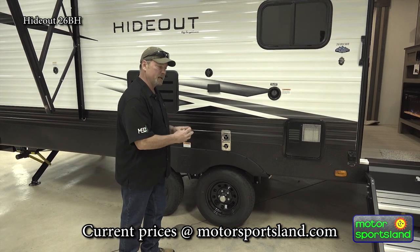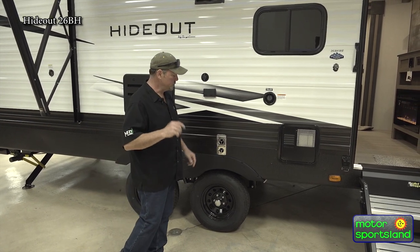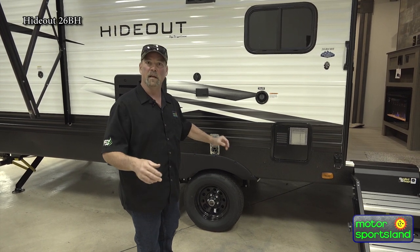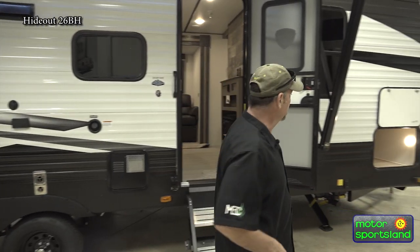It kind of greases back into that back bearing, pockets into the front bearing, and both get greased and both get nice. Little tip: as you're cruising down the road, you stop off somewhere to use the restroom for your kiddos or to go get something to eat, walk around, feel your hubs. Always nice. If they're super hot, stop, have somebody look at them. So that avoids a lot of creative mess down the road.